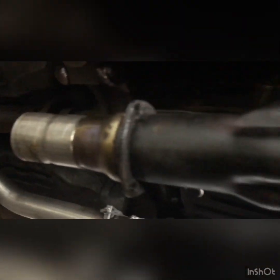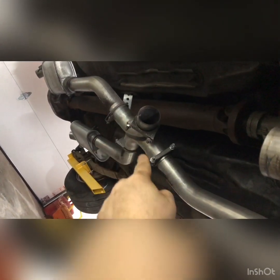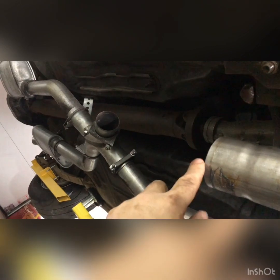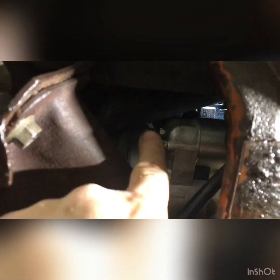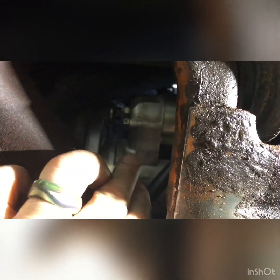So you can see I'm under the car and we've got the header — got this part of the exhaust unhooked. You can see I've got the X-pipe, two and a half inch exhaust. It fits up there pretty nice. We just took out this little bent pipe here — it's real easy, it's just bracketed on, so it's loose right now. And you can see here's the starter. This cross member — I don't think we have to take this off — but we can get to the starter pretty easily.